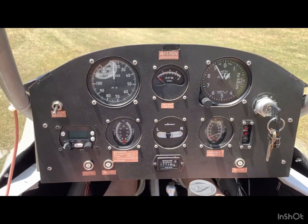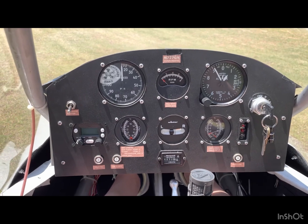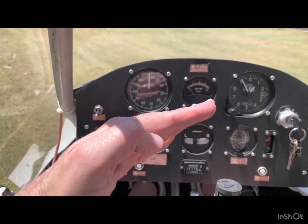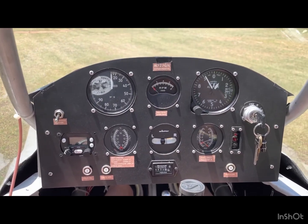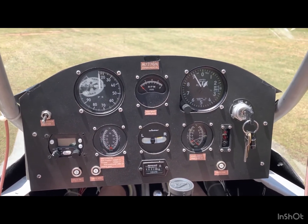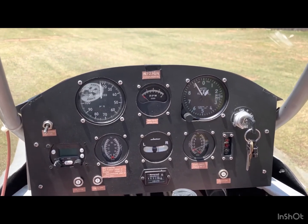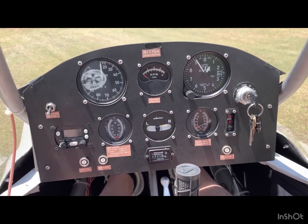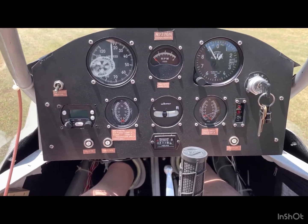I just went for a little flight and didn't really notice that much of a difference from the engine mod in terms of rotation speed. I was hoping that with the thrust line angled up and thrust going through the CG, and the small downward vertical component that introduces, it would help. But maybe it did a little — I'm not sure, I need to fly it more. The jury's still out.